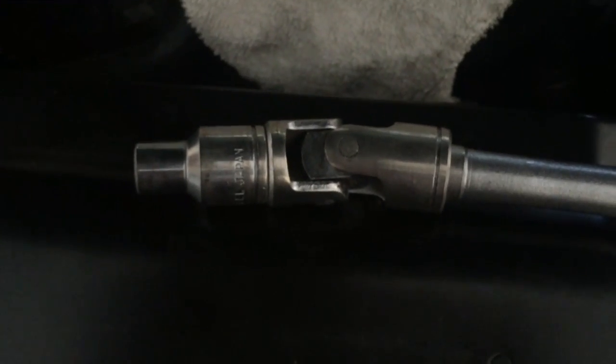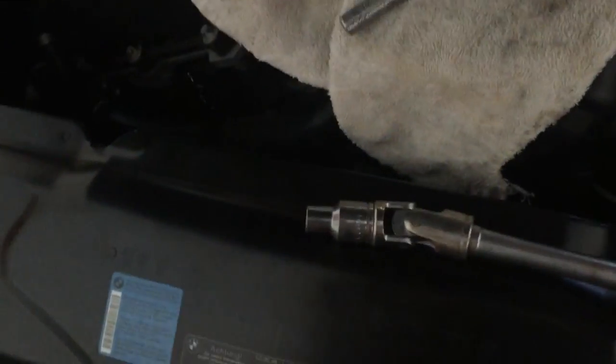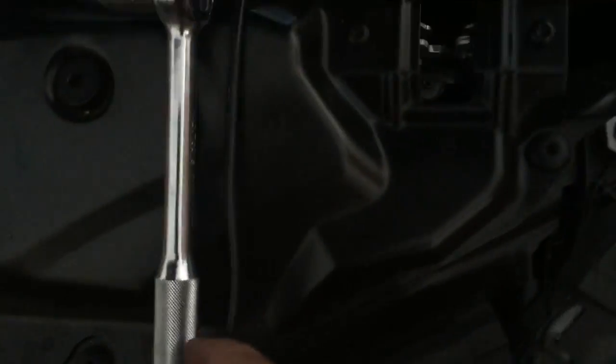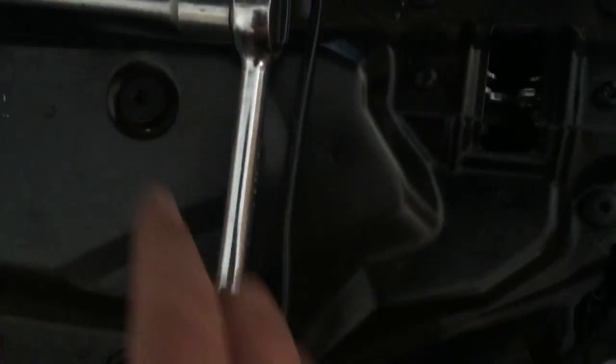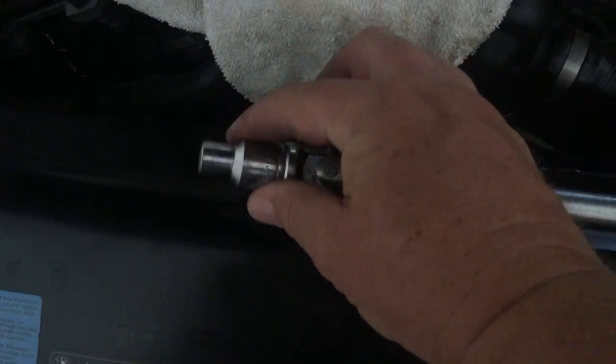I've been putting those fuel rail bolts back on and I deliberately had my small socket. That's the size of my hand. That's just a very small socket wrench for the light little work that I was doing. That was perfect for taking it off. But putting it back on, particularly over the back, I couldn't get that to ratchet enough to move, so I went for larger tools. This is a full-sized socket set, and I put a full extension bar on it with the pivot head on it, and then the nut. So with that, it was what I needed to get these bolts done back up.